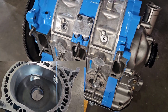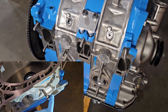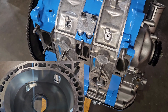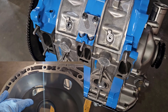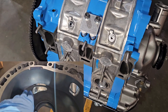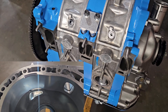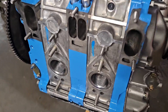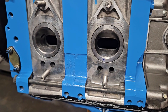The bridge port can flow a lot of air and has a fairly peaky horsepower. It's an aggressive port. So if you're talking about the similarity of what cam timing would be, this would be a very aggressive intake port opening — very early opening in relation to the same style of what a cam would be doing. Early opening and fairly long duration when it gets down to it. And then same thing on the exhaust ports — it's not a small port, it's not massive.